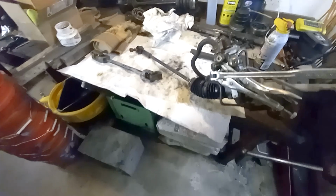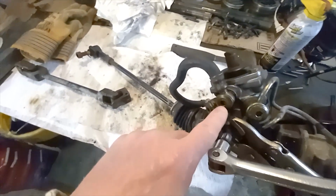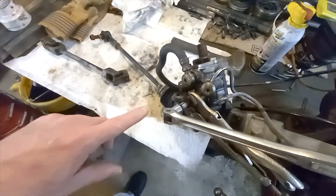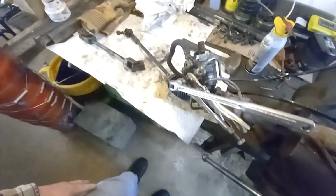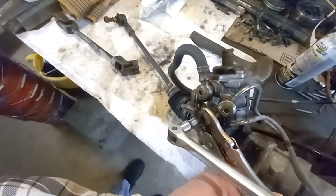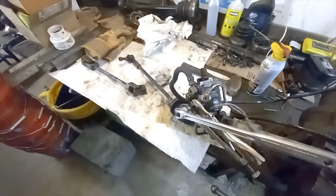And I don't know, I'm going to take it off. I've been fighting this. These are 6 millimeter socket head banjo bolts. Think about that for a second. And I've been cranking some pressure on it with this 6 millimeter hex tool, and it's not going. So what I did was grab the outer edge of the bolts, and we're going to try to basically use the vise grip and the hex tool to break it loose. Let's see how it goes.